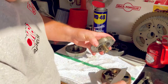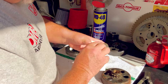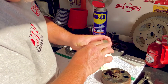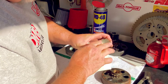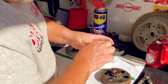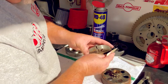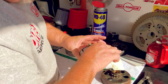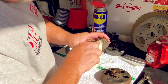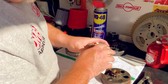When you have scoring on the shoes of the clutch, you can use some 120 grit sandpaper. You can lightly sand the shoes like this. Don't stay too long in one spot because we don't want a flat spot. We're just going to get this cleaned up with a little sandpaper — knock all the blueing and the ugly marks off and make this a serviceable clutch again.